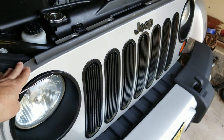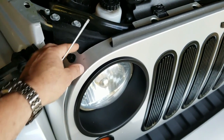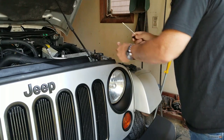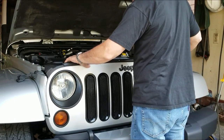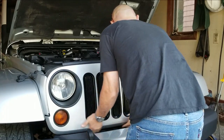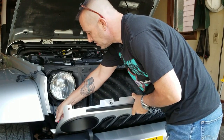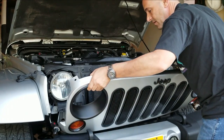The first thing I'm going to do is take the front grill off, and that's real easy. There's these little black tabs here — there's six of them. You just pull them off and they come right out, and the grill will come off. Now this should pull right out. There's clips under here. I can also unplug these light bulbs — they come right out, and that lifts right out.